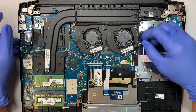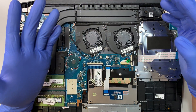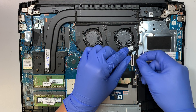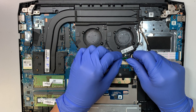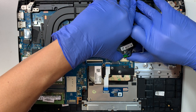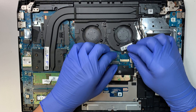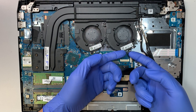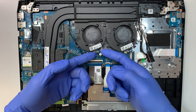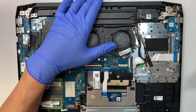This is your CPU fan. If your fan is dusty or not spinning correctly, this is how you remove and replace it. Let me go ahead and disconnect the LCD screen — this is a 40-pin LCD screen connector. This is your DC jack connector — push it away from your body to remove it. And this is the CPU fan connector — lift it up using your fingernails on both sides. Same thing applies for the left CPU fan. Let's go ahead and remove the screws.